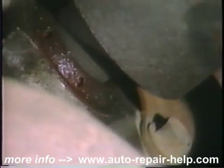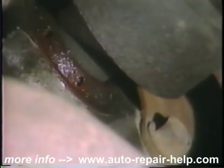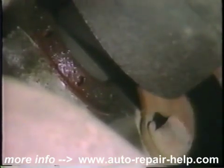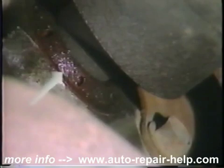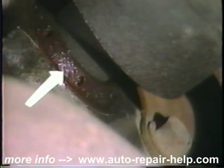Move the inner joint housing up and down to check for looseness in the transaxle output bearing and then check for rotational play. Also, look for fluid leaks at the output bearing seal. Signs of wetness here are often a result of a defective inner joint vibrating, which can cause bearing or seal wear.